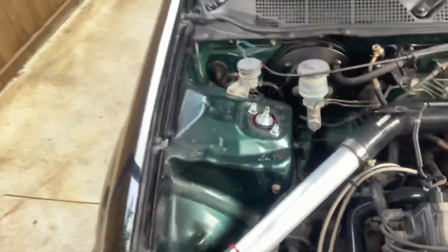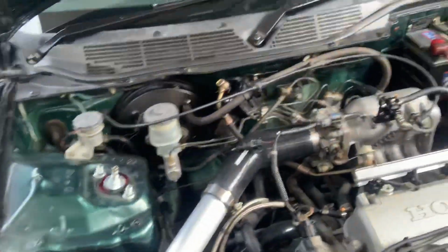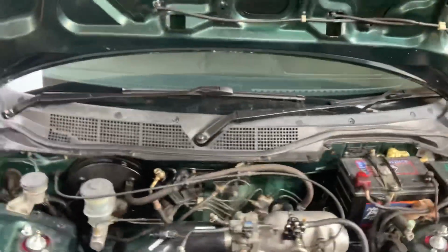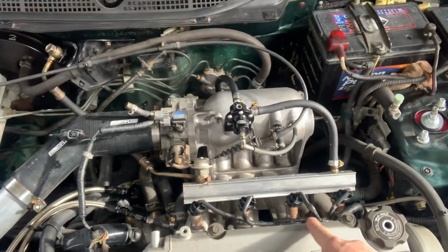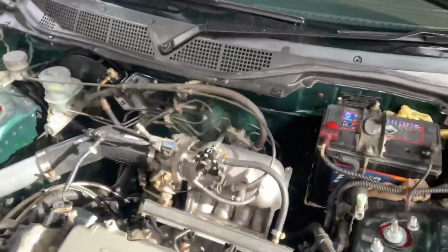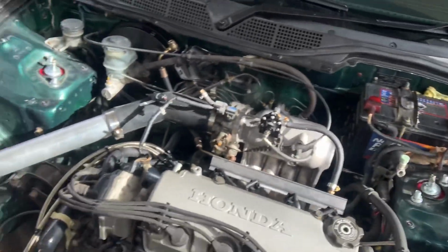In the engine bay, I've replaced this pipe here. Got rid of that extra ugly coupler that I had, so that's neatened that up. I will eventually paint that. I found a place in Dandenong called Trick Fab, which I got that from. I'm going to get a weld-on -8 fitting for here, and another one for here somewhere for an oil breather. And Hawkeyes will see I've put a very small hole in there, about 8 millimeters, just to help the engine breathe.